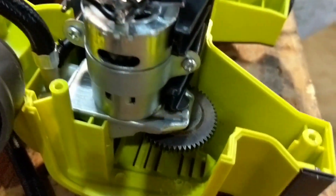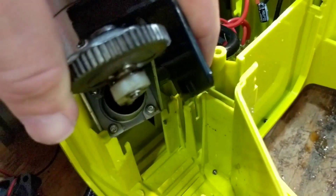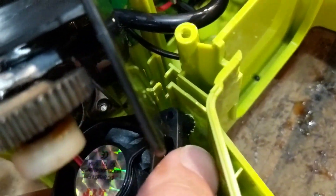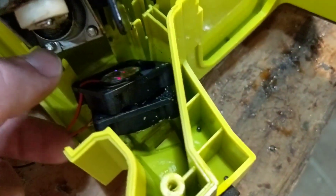The compressor itself is pretty small compared to anything professional — it's basically just this little geared piston. You can add additional grease to that right in here. And then I was thinking about these vents; this fan here pushes air out the back. So this is the intake, and I was thinking that'd be a nice place to add a couple of case fans to pull air in, so they're cooling it down during that 10 minutes off — maybe turning that into five minutes if it's well ventilated. Maybe I'll add more heat sink in there too.